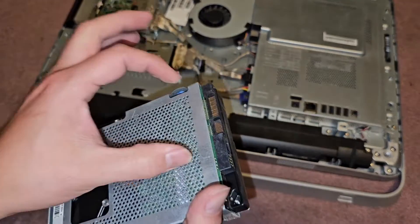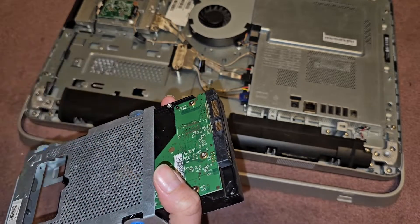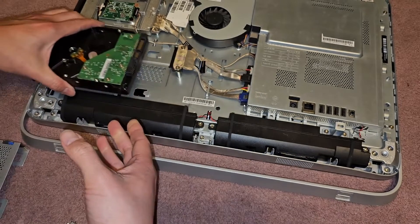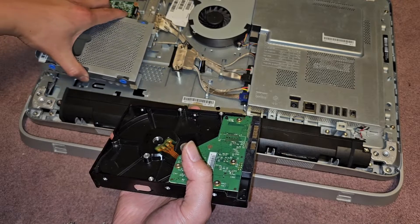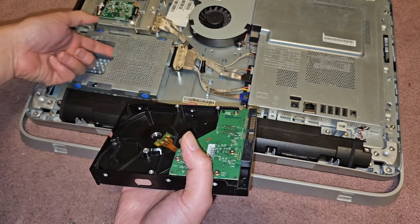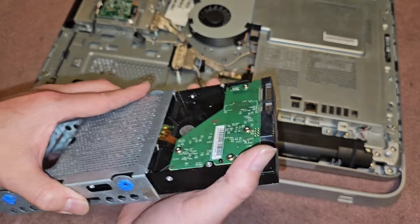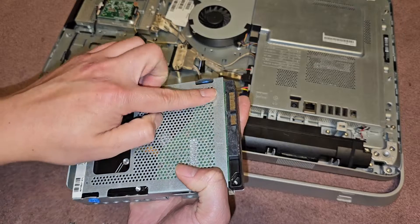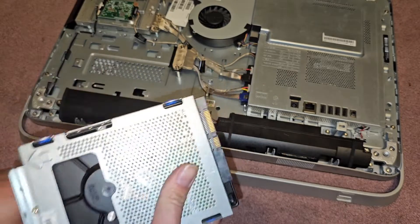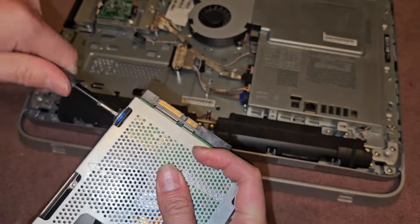If you're using an SSD it's much smaller. You can roll some tape backwards so it's like a loop — sticky on both sides — or use double-stick tape, and stick it on the SSD, then slide that into the connector. Be very careful as you slide it in. If you really wanted to upgrade to a 2.5-inch SATA SSD, it is doable and I highly recommend it.